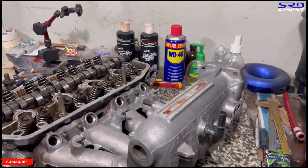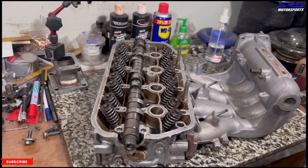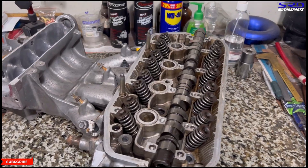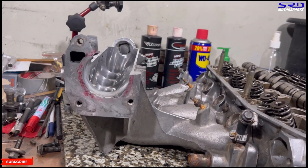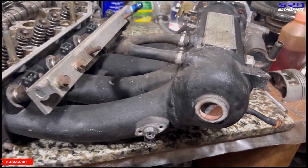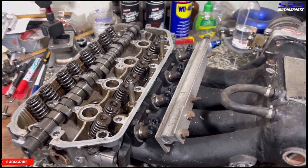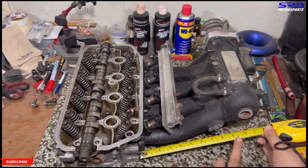The plan for this series: we're going to dyno first with the stock PO8 / D16Z6 ESI intake manifold, then dyno a ported PO8 — this exact manifold — and finally dyno the actual setup with the ported Skunk2 Pro Series intake. You can see all the welds where I kept punching through to get maximum taper even at the bottom. So whatever the ported PO8 makes, the ported Skunk2 is going to be even better. It's a direct, unbiased comparison — same engine, same setup, same exhaust throughout.